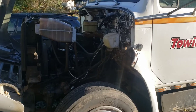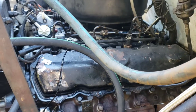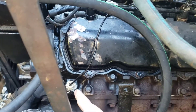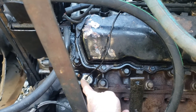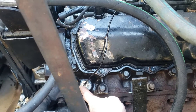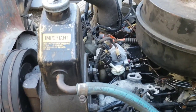I just wanted to give you guys some alternative places to put in your sensors. I've got my temp sensor going in here, but I'll tell you that that port usually operates your dash warning light. So if you're overheating, your red dash light's not gonna come on anymore if you use that port for your gauge sensor.